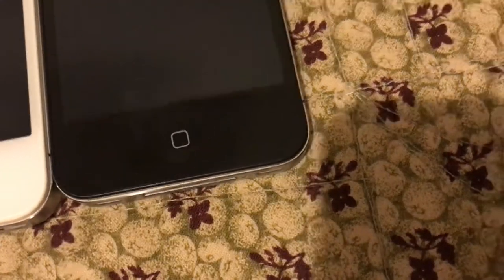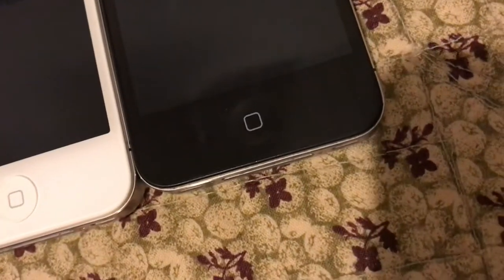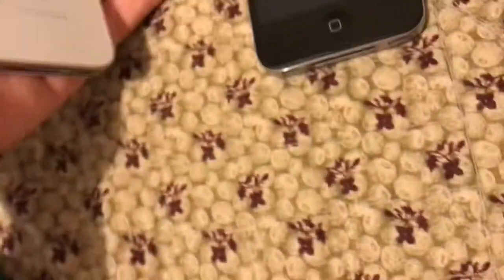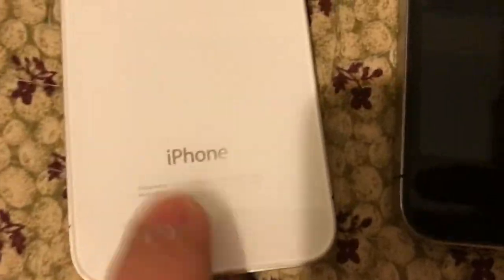So now I can tell differences between the iPhone 4 and 4S. The CDMA iPhone 4 doesn't have those labels on the back, but the GSM one does. The GSM iPhone 4 has a SIM card tray and an antenna band on the top. This one doesn't have a SIM card tray, but has the antenna band on the side.